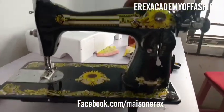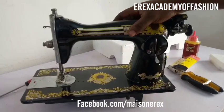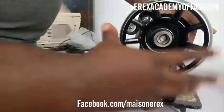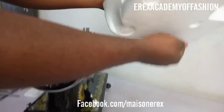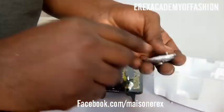Turn to the side that houses the balance wheel. You can see how the machine comes — you definitely won't be able to use it in this state. Take the balance wheel and fix it in; it automatically fits in well. Then you need to lock the hole with the round washer. Bring out the locking piece — it works like a lock-and-key mechanism, and you can see the shape on it. This locks up everything for the balance wheel.